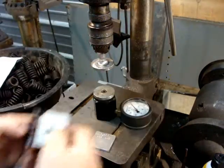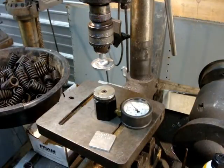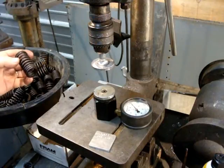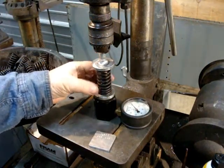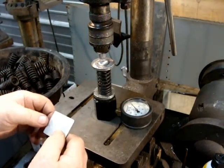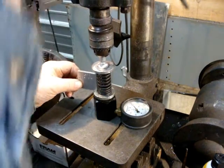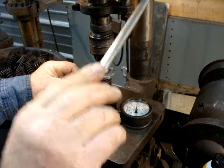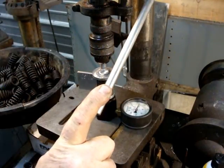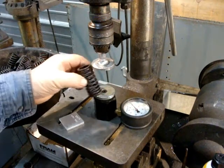It's great for the R2. My problem is I have a whole bunch of takeout springs over here. So I'm going to take the assumption that they're all just stock springs, and using the 1.671 spec from the service manual, they should all be between 105 and 115 pounds. So now this is just a nice go/no-go thing. Here I'm touching it and I'm right on the button — this is a good spring, it's right at 115. That one goes in the keeper box, and we go to the next one.